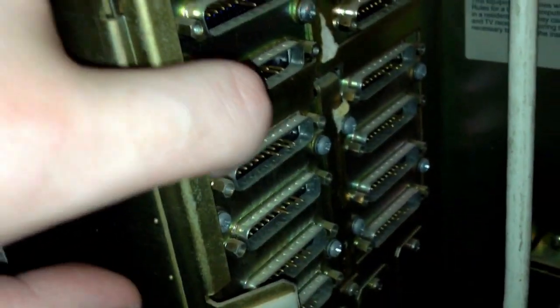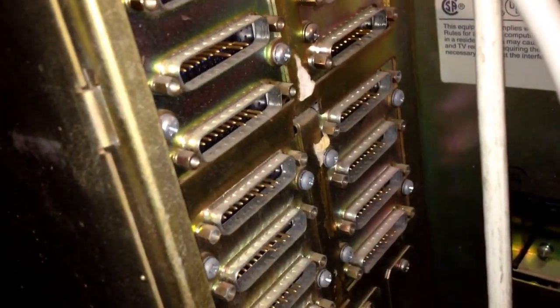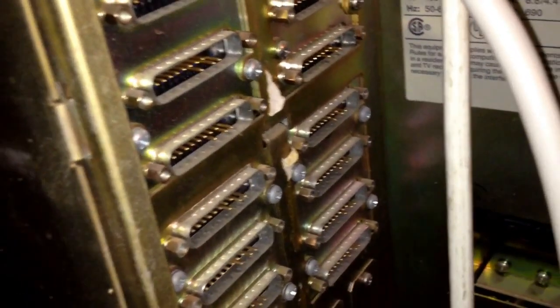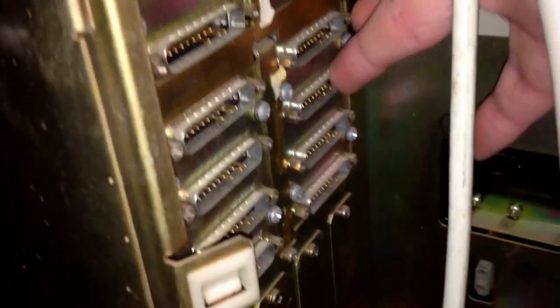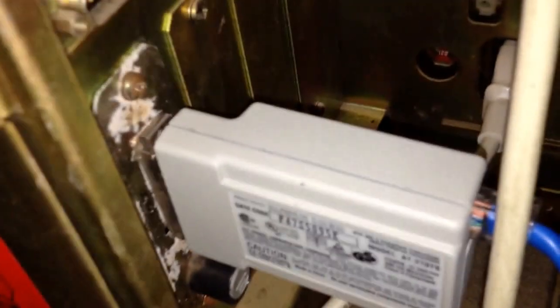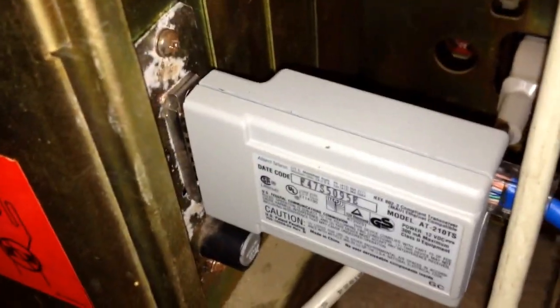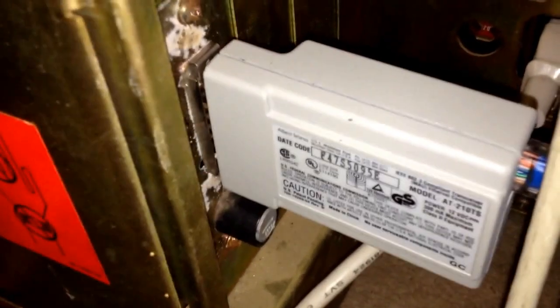I only have these two connected at the moment, because I don't have a 16-line board or a second DHV11 configured, or cables to bring up the rest. And here is the breakout connection to connect the VR290 to the VCB02 bitmap graphics system. Here's an AUI transceiver to connect my 10BASE-T network, which really isn't 10BASE-T, it's a mix of gigabit, 10BASE-T, and 100 megabit.